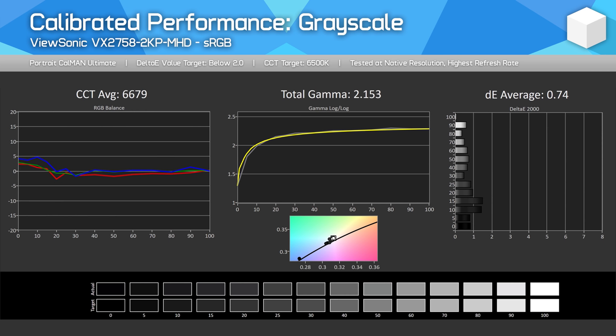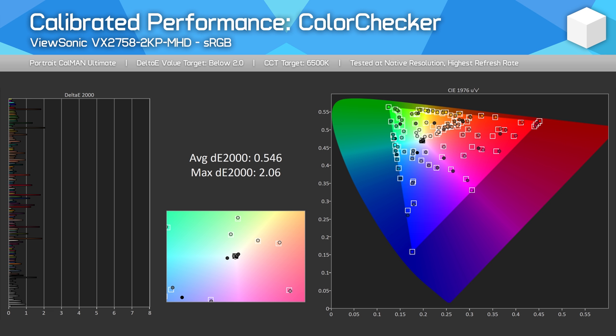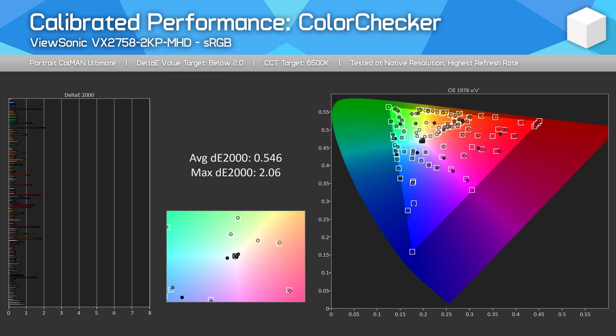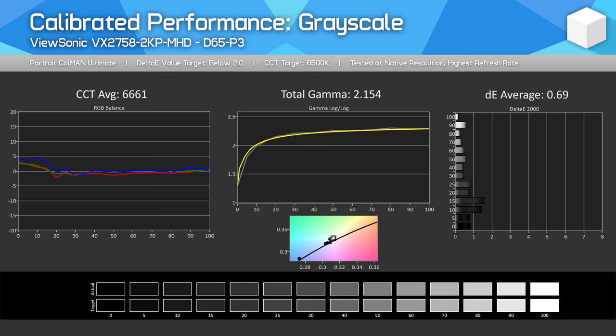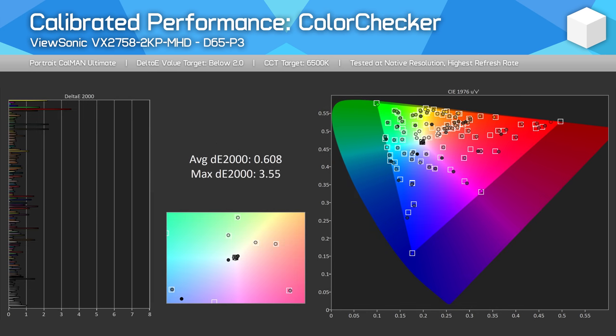As far as I can tell there's no sRGB clamp in the monitor settings, and because factory grayscale is excellent, there aren't OSD settings that can improve performance further. The only way to improve accuracy is through manual calibration. After calibration, grayscale improved slightly to a sub 1.0 delta E average, and sRGB colours are properly mapped, producing excellent calibrated delta E performance. For DCI-P3, we're looking at around 95% coverage — consistent with most wide gamut IPS gaming monitors. Blue performance is excellent, while greens and reds are clipped slightly at the top. This is still better than most wide gamut VAs, which are more in the 90% P3 range.